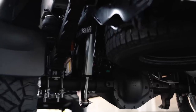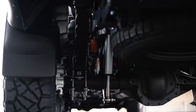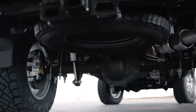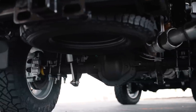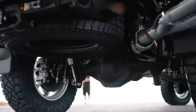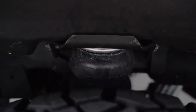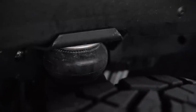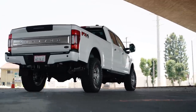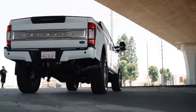Going to the rear end of the truck, it has the Carli full progressive spring pack as well as their custom tuned shock. That setup is going to get rid of all of that unpredictability from the rear — all of that harsh bucking that you feel with stock springs is eliminated, while still allowing you to haul an okay amount of weight. This customer has a trailer, a heavy boat, things like that. So he wanted to supplement those full leaf springs the best he could. We used a Firestone airbag package with some of our own custom hardware and the Firestone compressor system. This allows the customer to hook up his boat or his trailer, grab his remote, inflate the airbags, and he's ready to tow.